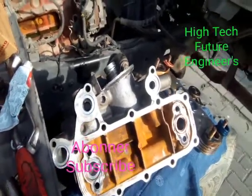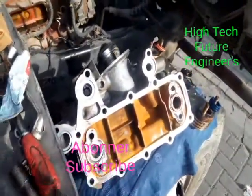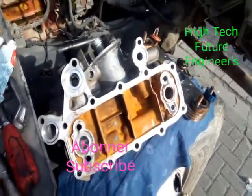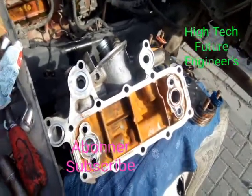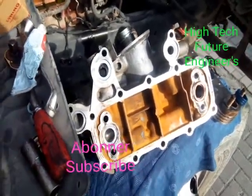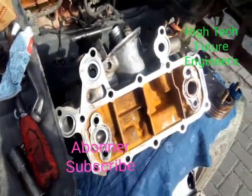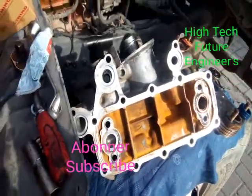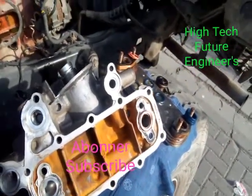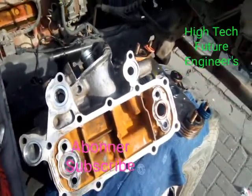Someone might go and start opening the head, thinking maybe the head gasket is bad and that is why it is passing oil. But my recommendation is: never first start with the head gasket — always begin with the cooler. After checking the cooler and confirming the gasket and O-rings are good, it is always advisable to replace, not to put silicone or do some patch-up. Change everything so you are clear from that side. A good mechanic doesn't work with guesswork.